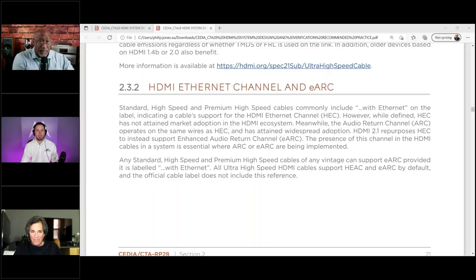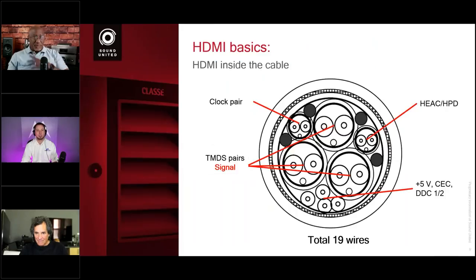There's a webcast that I'll be doing in January with one of my HDMI expert friends. And the topic's most likely going to be something along the lines of, not all HDMI cables are created equally. And he does a lot of HDMI cable testing. It's really funny to hear some of the things we've talked about so far, where some manufacturers will skimp out to keep the cable a little bit cheaper if they leave out some of these things. So to your point, Phil, even if the cable's brand new, it might not have the Ethernet channel built in, therefore you won't get the good stuff. So for those of you listening, just a tip, don't always base off how old the cable is. Dig a little bit deeper into the cable manufacturer and read the specs and make sure that stuff's there. Because there's a whole lot of wires in these HDMI cables.